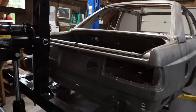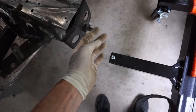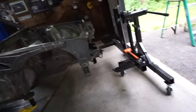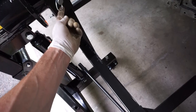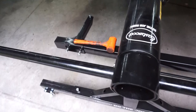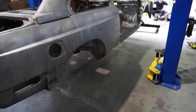I'll swing that front one around and see what we've got. Because I'm using these bumper mounts to attach this, I'm going to weld directly — which sadly means I'm going to have to buy the DTM aluminum ones. The back's done, car's level front to back. Now for the rough adjustment on this guy: you take this pin out, pull it up to whatever hole you want, and stick the pin in. You have to screw it up with the screw and then put the pin in — it's actually very safe. And when you raise it with the jack, this thing has a little roller that levers in slightly because of the load, but the roller handles the load. Really nice setup.